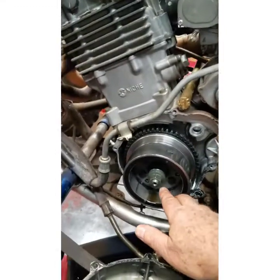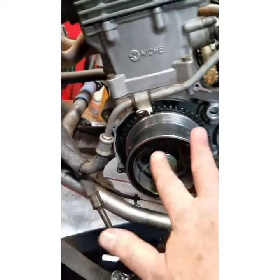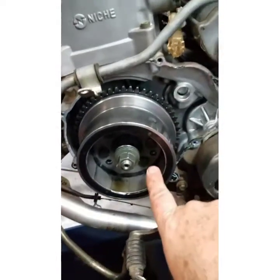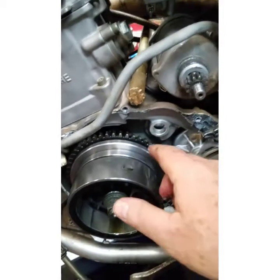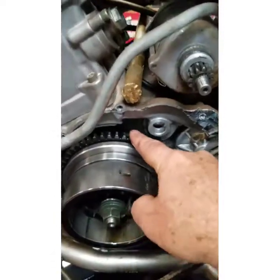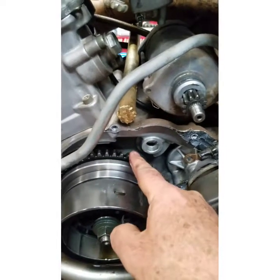For years I've used a 79 Chevrolet 350 harmonic balancer puller — it's a three or four-prong puller you can buy anywhere. It works great because you need a three-hole puller to pull this flywheel using each hole. I think those are eight millimeters. With the nut off, you put the screw tension there and with my air wrench, zap it off. Or you can buy a puller on eBay. That's your starter clutch — it grabs going this way, that starts the motor. Then when it stops, the starter gears stop moving and it'll freewheel backwards to let the motor run.